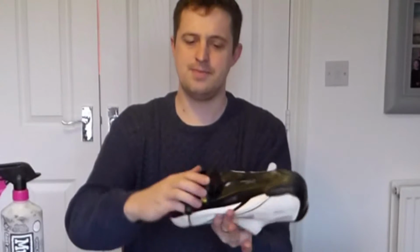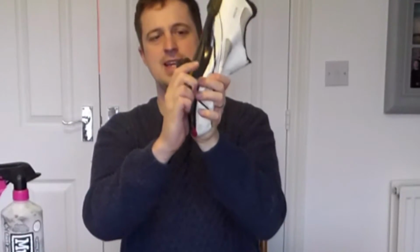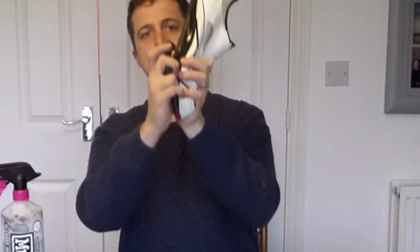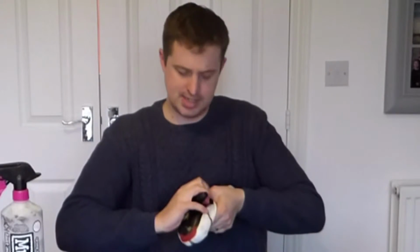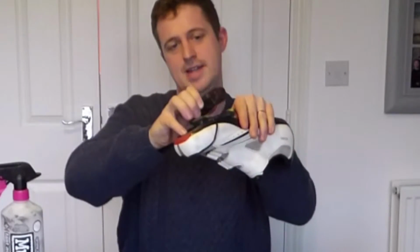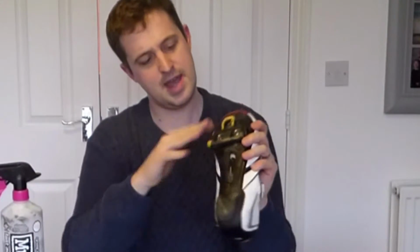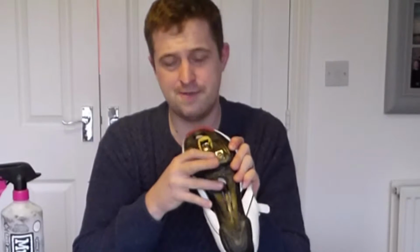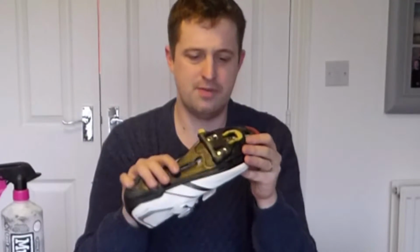So when you take this out, you're going to twist your foot outwards as you take it out, and you can see this bit of the cleat is lifting up and coming out. Can you see that? And then when you flick it hard enough, which is pretty hard when you're doing it with your hands, this is going to flick off and flick out, so that then clips off. So that's come off, this bit has come out, and it's come through. So when you're looking for wear on your cleats, you really are looking underneath. You're looking underneath here, and you're looking for this flat bit on the front here. And if there's real wear in those areas, then you know you've got a bit of a problem.